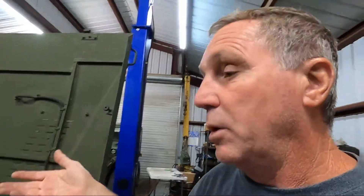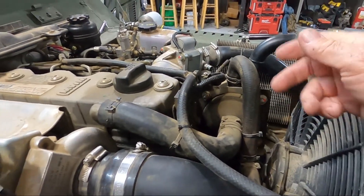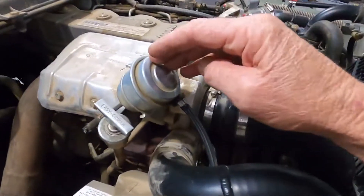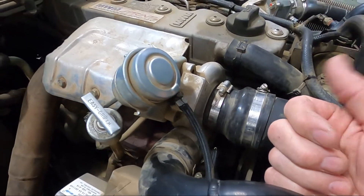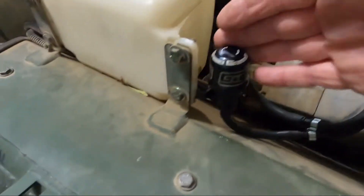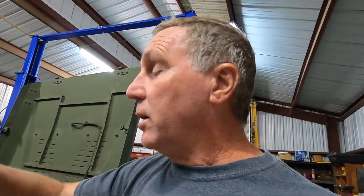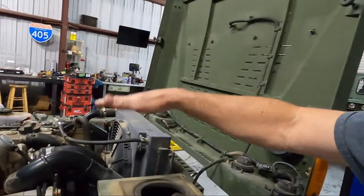That's what I had to do to remedy my problem because of my transmission computer being changed out. If this valve is bad you can buy it — I would stick with the stock one if you can. But if you can't get this valve for some reason and it goes bad, don't hook the line directly from the wastegate valve to the turbo thinking you'll make it work better — it's going to make it worse. If this controller isn't working for you, a boost control regulator is an option. One other important thing is to test your boost — I'll cover adjusting the injection pump governor for smoke and power, and checking your air cleaner and boost leaks.